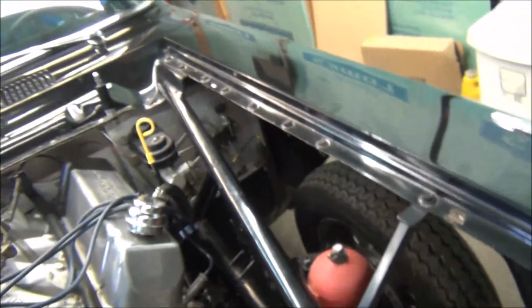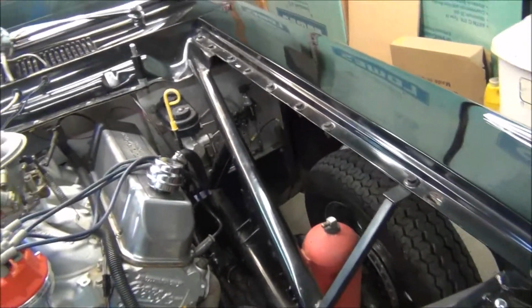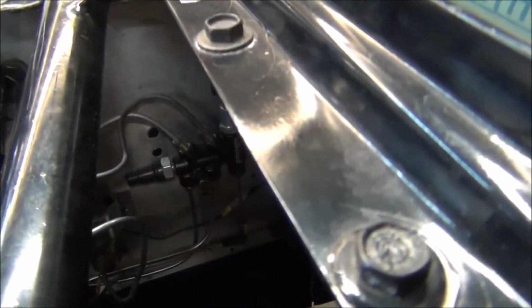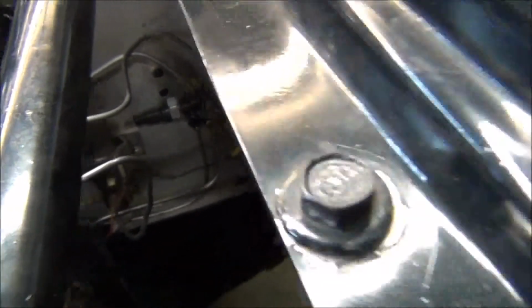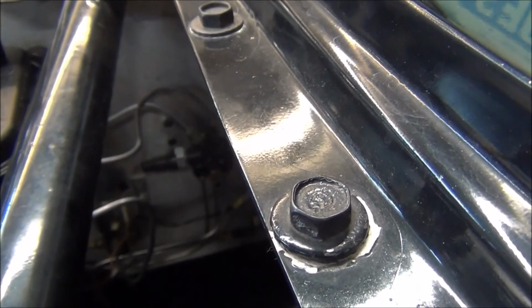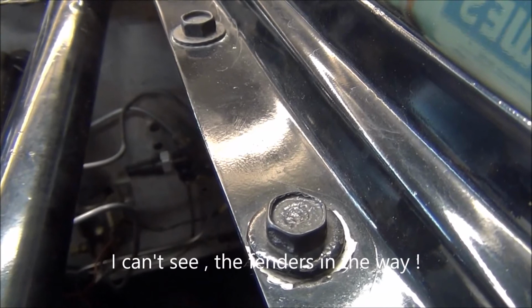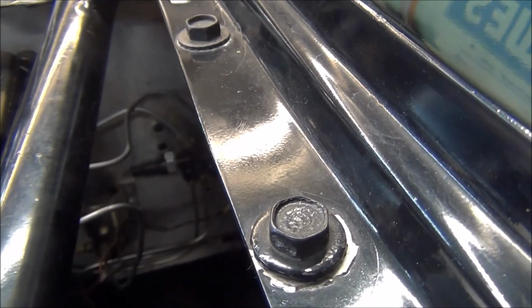And on the adjustment, I'd have to get the instructions. Actually, I had to look up the instructions online because I had no instructions. But I think less pressure, to see, this adjusts the rear only. And if I remember right, it's like an air pressure regulator. The farther out you have it screwed, the less pressure it goes to the brakes, and the farther in, the more.